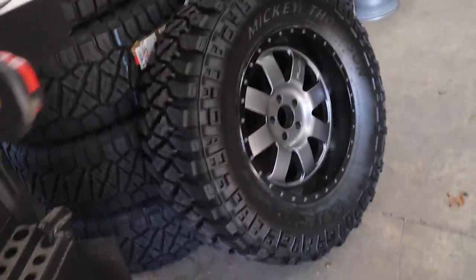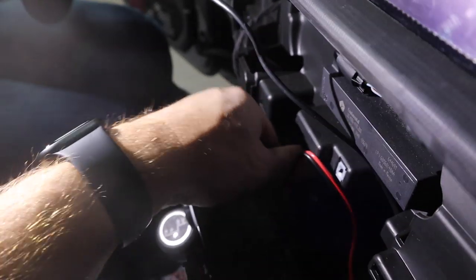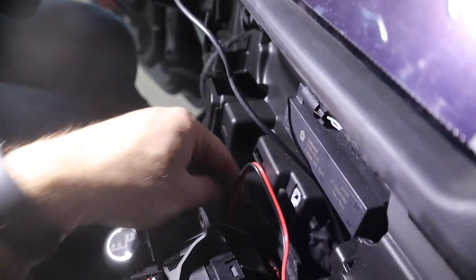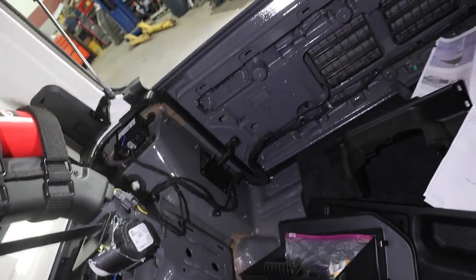We spliced into the DC power wires — it's going to be the pink and the dark brown. The pink's going to be your hot; we tested it. And the dark brown or black — we spliced into that for the ground. We zip tied the unit in there. The wires just run across. Tracy has the pillar panel pulled up and in the back everything is zip tied nicely to the existing harness. Everything just needs to go back together in the back and everything's good.